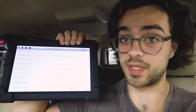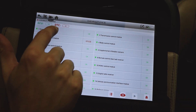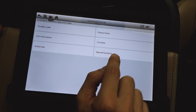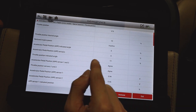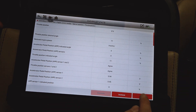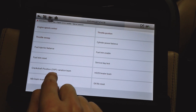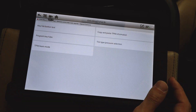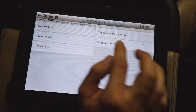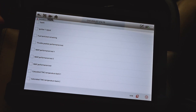This is where it's a big deal for a mechanic. You can record your data just by pressing a button — it starts recording the entire screen. Not only that, this unit can also do special functions. You can literally change the throttle position sensor, do an auto sweep, fuel trim reset, crankshaft position variation re-learn, oil life reset, auto learn reset. You can also program key fobs and do a key fob button test. It has a lot more options for live data as well — fuel trim, intake manifold pressure, throttle position.